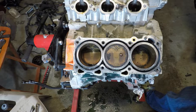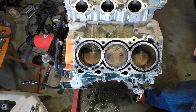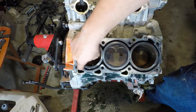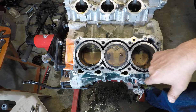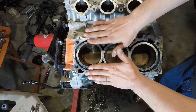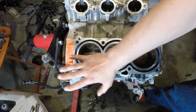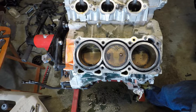My deck is machined by a cylinder support system. What that is, it's basically a CNC machine block guard. They machine down into these coolant grooves here, a certain dimension down into it. Then they have a CNC machine block guard that drops in and it sits on a shelf inside here. Then they come back and they basically mill it all flat. It's essentially a closed deck modification — that's technically what it is.